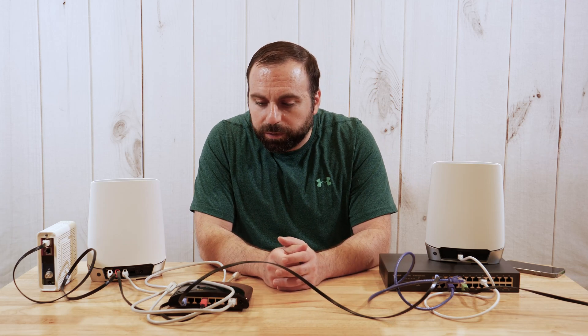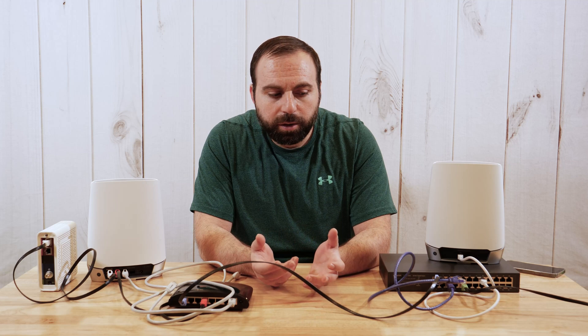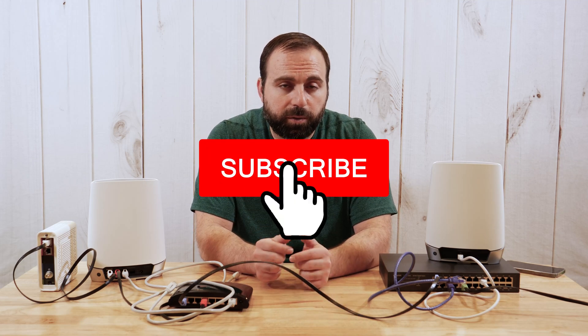You are limited to 253 usable devices. So if you keep adding 24-port switches and pass 253 devices, it's not going to work unless you start changing settings like subnet mask. But in most cases, 253 devices is more than enough. The reason it's 253 is because it's actually 256 — but the first address (.0) is reserved, the last (.255) is reserved, and one is usually reserved for the gateway router. That's why you get 253 usable addresses. Most people don't need that many. If you guys have any questions or comments, please leave them in the comment section below. Thank you for watching, and thank you to all my current subscribers. Bye!